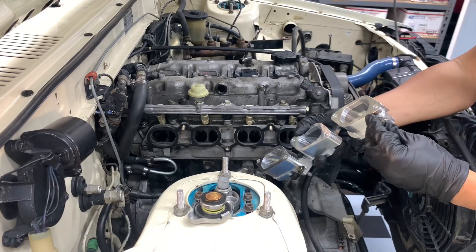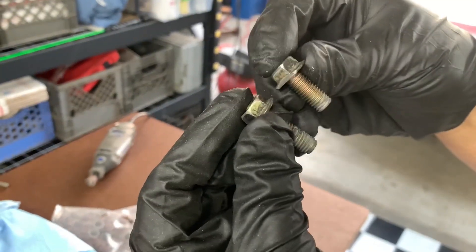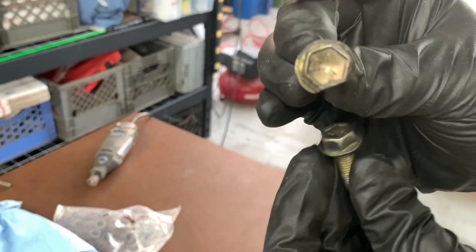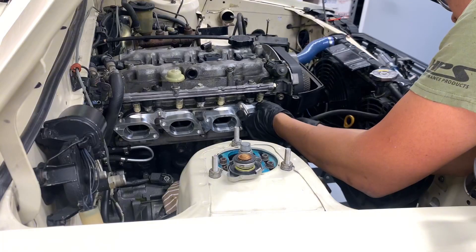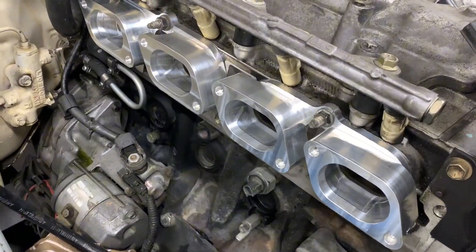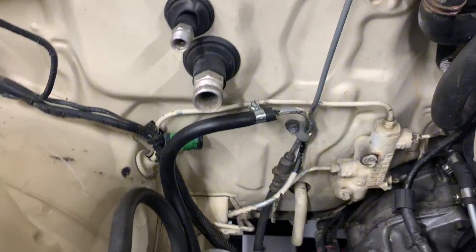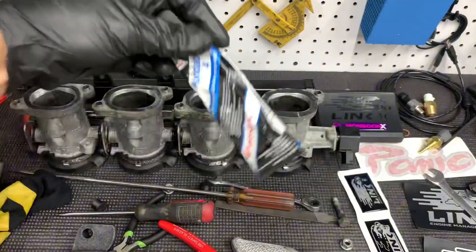I'm going to chop this a little shorter. I cut this bolt shorter and cut the flange off — it just fits with enough thread engagement. I got this tightened down and sorted the fuel line and clutch line so they're free of the linkage.